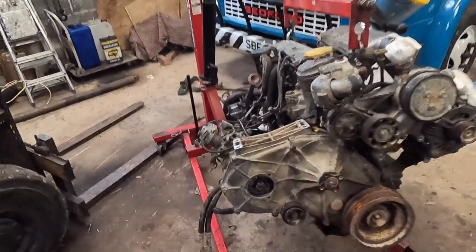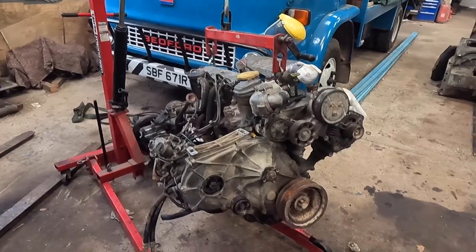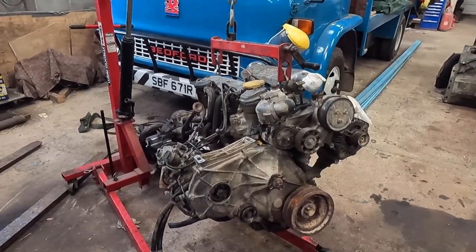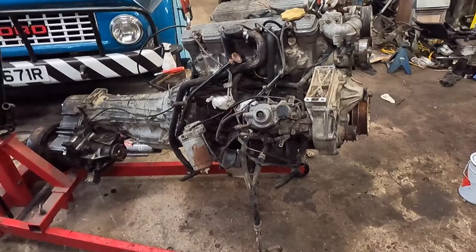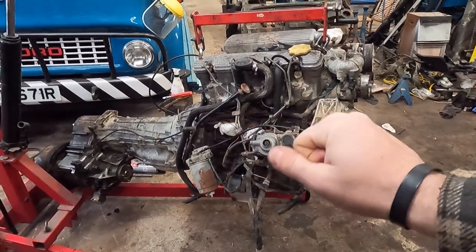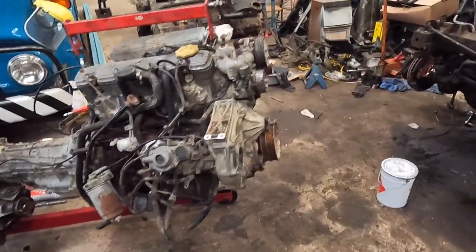The other thing Demo came out with yesterday — my aircon pump that was on here came out of a Range Rover with aircon. What he was saying is the aircon pump can be turned into an air compressor with a few changes and a recondition. So he's taking that away with him and he's going to turn it into an air compressor, so then I'll have a remote tank somewhere on the vehicle that can power the air lockers, do tyre inflation, and possibly power tools as well. Nothing better than repurposing something. We've also got to redo the auto gearbox cooler pipes to the front and get that big thin radiator on.